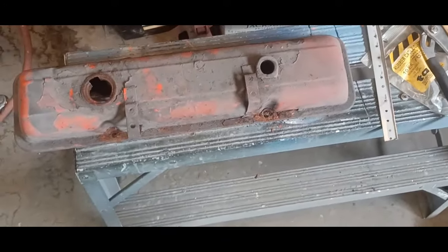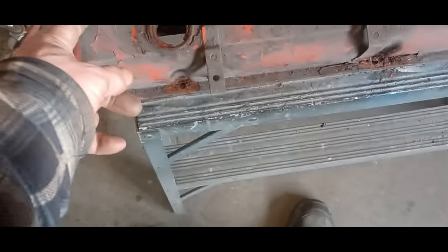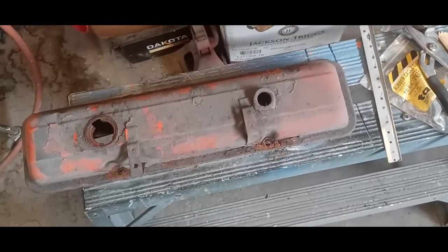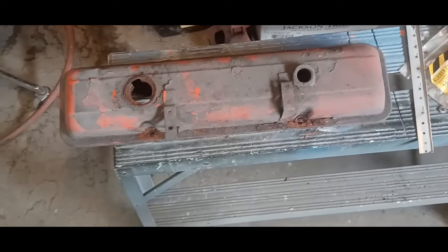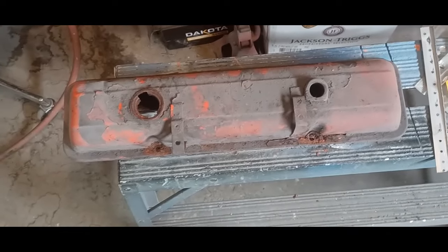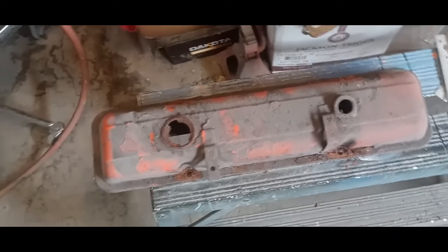Okay, so here's what I'm doing. I don't want to get a mess all over the engine bay when I run this thing and we're checking out valves and all that stuff. So I'm going to just cut the middle out of this valve cover so that most of the oil will stay inside, and we'll still have access to the rockers. So I'm going to cut that out, clean it up a little bit, and just put it aside for now until we do that. It was my buddy's suggestion. It's a good idea. I'm never going to use this valve cover again, so I mean, it's horrible, it's dented and everything else. So anyway, that's what I'm going to do. I'm going to cut out the middle, and then we've got something we can use to run the engine, get at the valves, and listen to them while it's running without getting oil all over the engine.